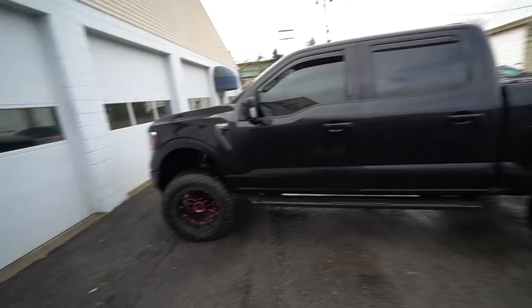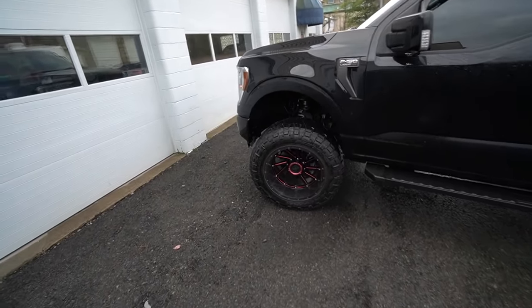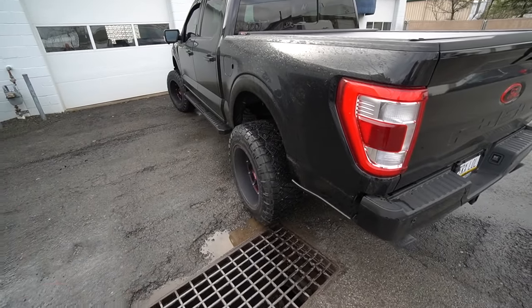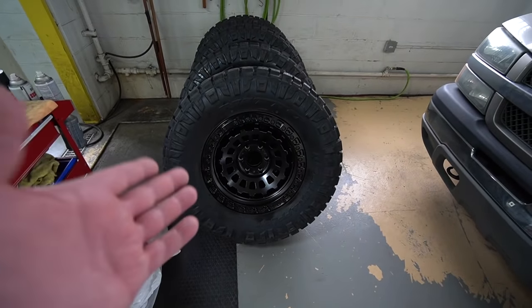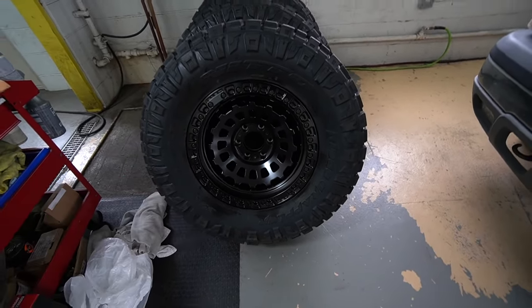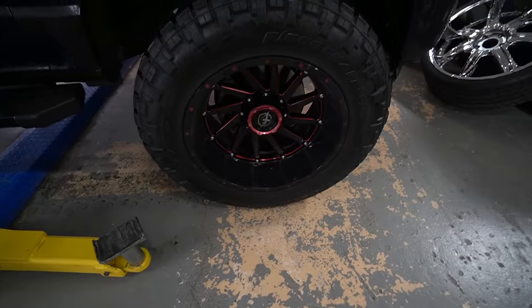You guys remember the previous video where we were here and the whole debacle with putting new wheels on. We're finally switching out the 20x12s that we've had on all my trucks for four or five years. We're getting some proper wheels - these are 18x9s. The previous video we tried 17x9s that didn't work out at all. Long story short, I should have read the instructions with the lift kit - you can't fit 17x9s because of a new steering knuckle that relocates the tie rod and it was hitting the wheel.